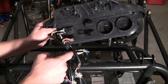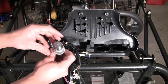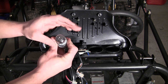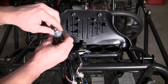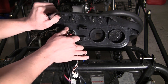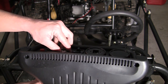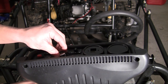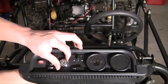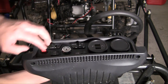Now the next one right here, this is where your ignition goes — where you turn in the key. But you put this in a little bit different than just the clip. If you're wondering where to bolt this thing on — nope, it's not fitting by just sticking it through. What you need to do is unscrew the area around the tip of the ignition or keyhole. Then go ahead and put it through, and on the other side go ahead and thread it — these threads are always a pain to do. All right, there we go. Now that it's tight, you can stick the key in and turn it and it's going to kick off your starter.